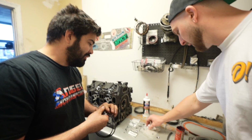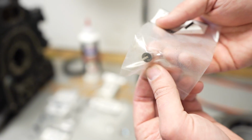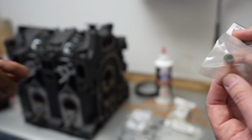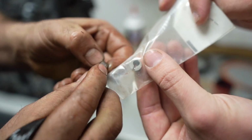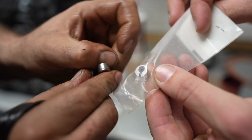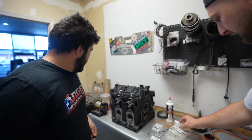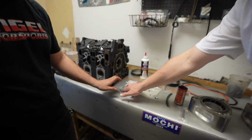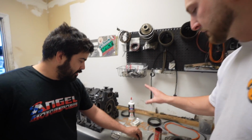And then you were telling me before about the side seals, how they have a lot more surface contact than the aftermarket ones. Yeah, the aftermarket ones have less surface area contacting the plate, so these build better compression than that. And then I see OEM springs. Yeah, OEM springs, OEM corner seals, same thing. And then everything else we're using aftermarket.